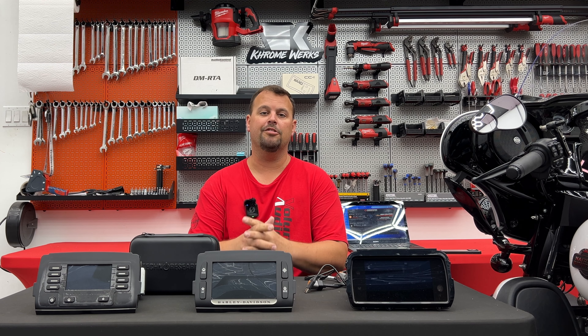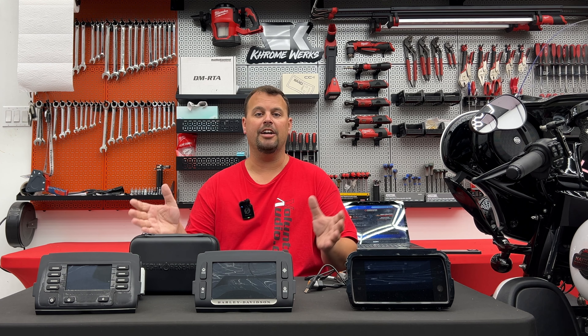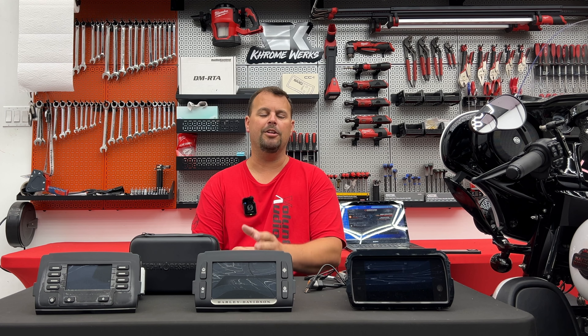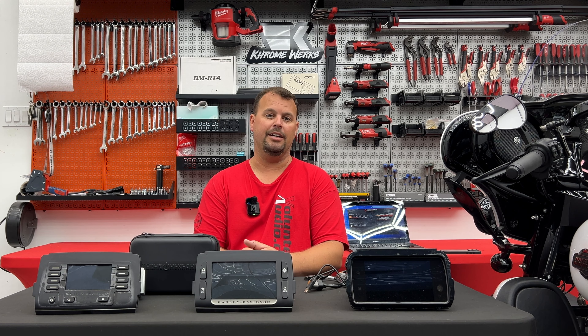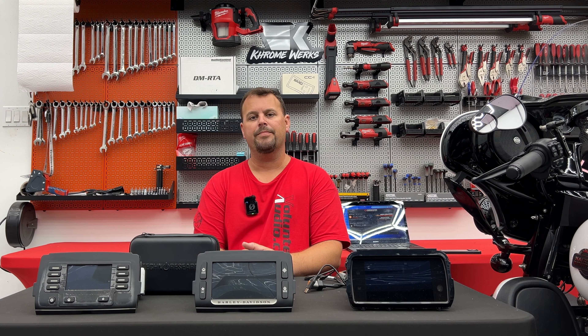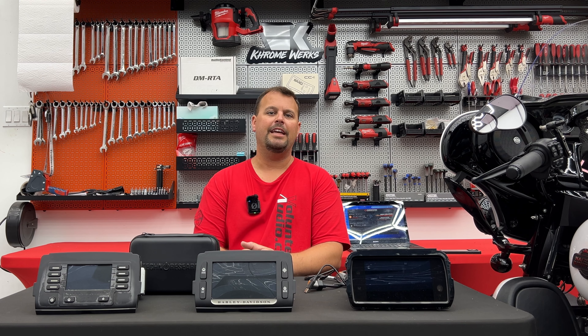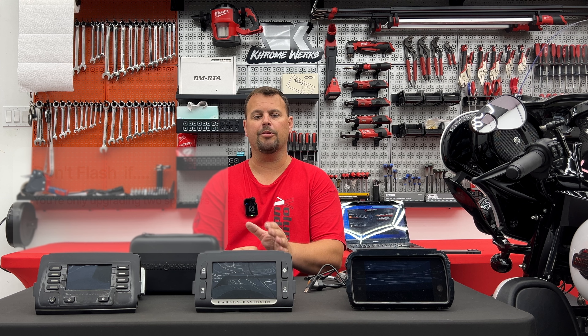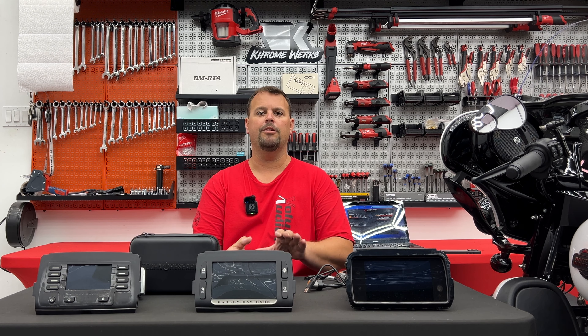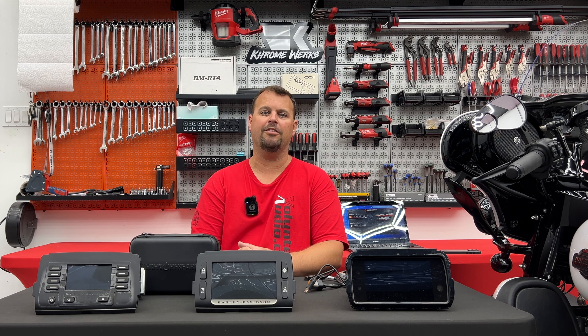The purpose of this video is to tell you when you do or do not flash your stock radio, and I'm also going to go over what happens when we do that flash. So let's talk about when we do not flash our radio. If you have a Street Glide, Road Glide, or Electric Glide — leaving Ultras out for right now — and you only have two speakers in the front fairing, you're only going to flash the radio if you add an amplifier. If you're looking at just upgrading your two speakers with the stock stereo, you're not going to be doing a flash, because when you flash your radio correctly you actually lower the output of the radio for an amp. We don't want you to do that if you don't have the desire to add an amplifier at this time.